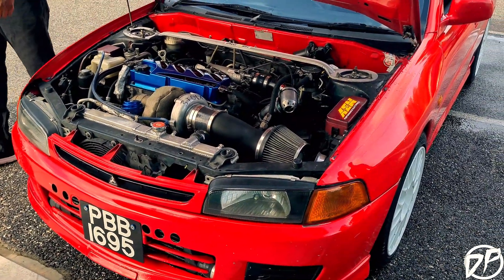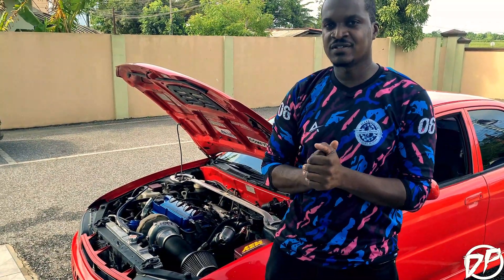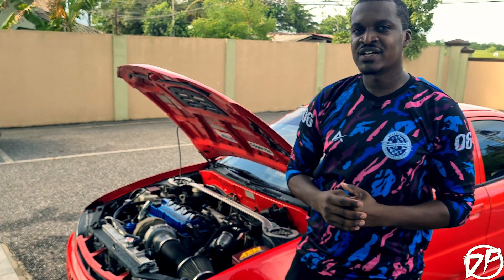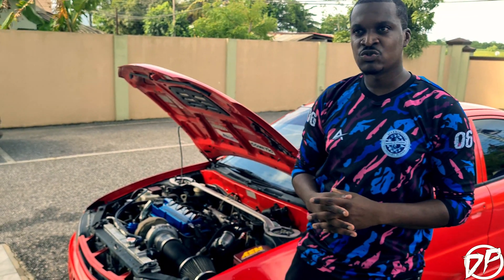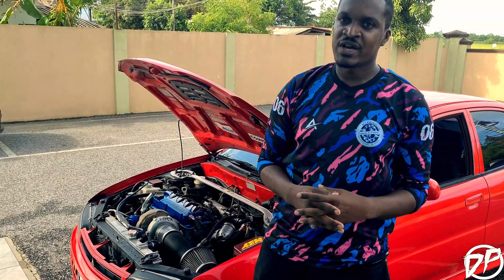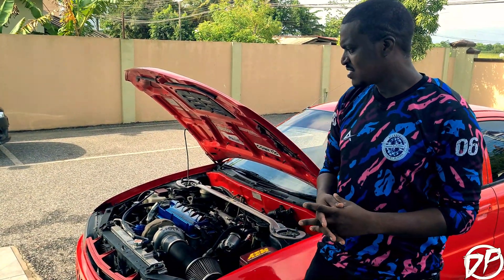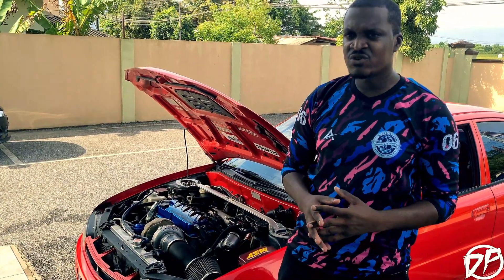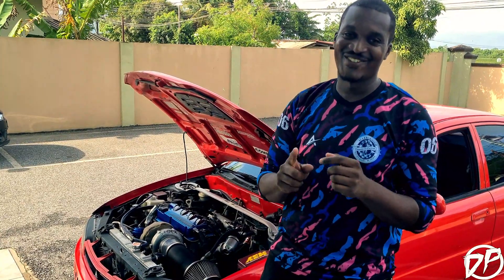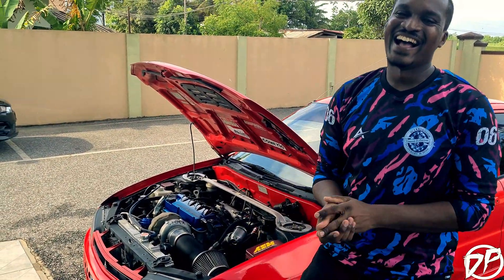I'm always fixing something because I'm always breaking everything. So let me just get a little rundown from him on the setup of the car. Here is Brandon White, also known as Brand Fab. Basically a rally art engine — the US and UK came with a 2.4 MIVEC single cam engine, so that's basically why I chose to go that way, something different. It's basically semi-forged with Eagle rods, H-beam rods, and K24 pistons — putting Honda parts in the Mitsubishi to make power.